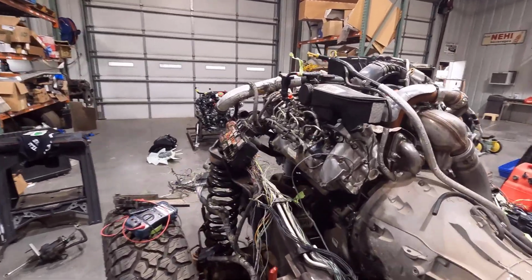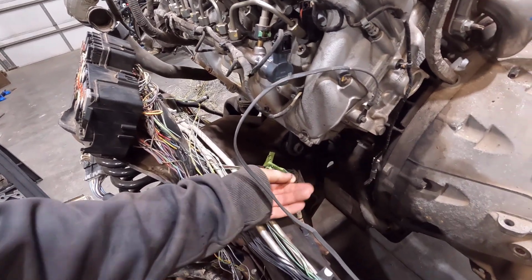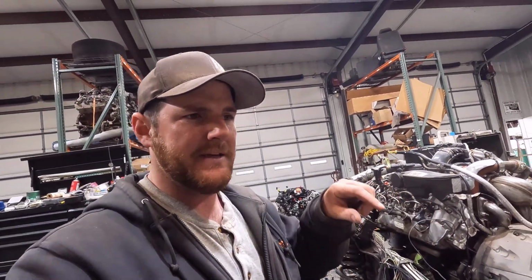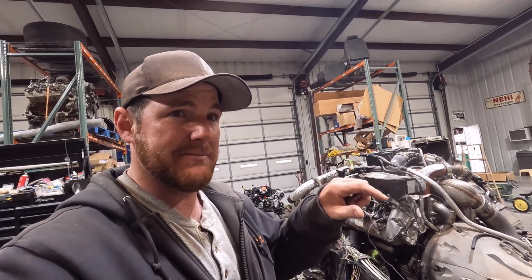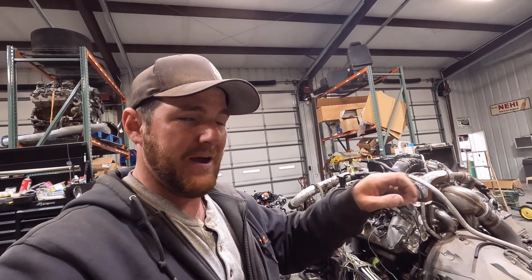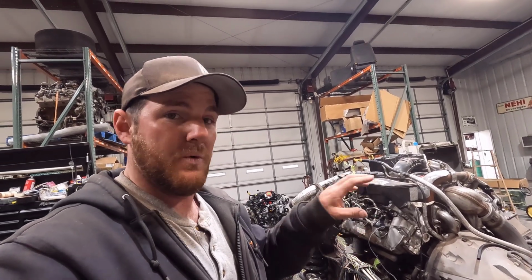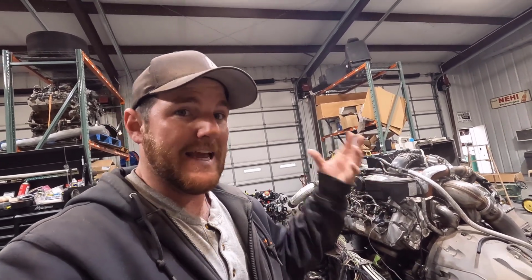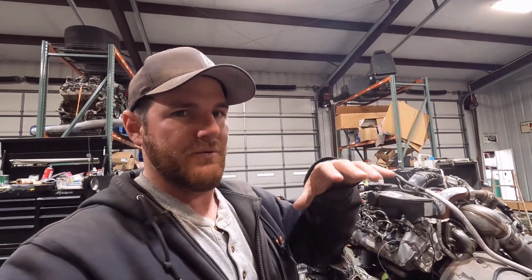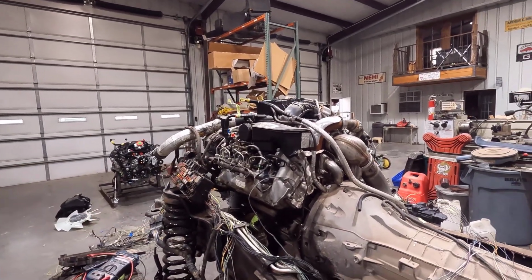And I found the lights. So these two lights are the four-wheel drive light and the four-wheel drive low light coming up. They went up to the dash. So I might be able to get some custom lights made that say four-wheel drive low and four-wheel drive high, because when you switch, it sometimes is delayed, and you might have to roll it back and forth and stuff. And since I don't have that data display in the dash, it's not going to tell me that. So if I switch it, I won't know if it's in gear or not. So with those lights, once they light up, I'll know that it actually did shift, and it's actually in four-wheel drive low, or four high, whatever I'm in. So I might do that. That's at the end of the project kind of a deal.